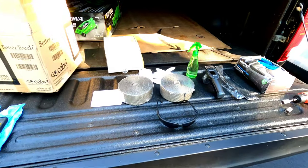Is wrapping going to make your pipes brittle or rot them? The answer is no. Most headers now are pretty awesome stainless steel pipe, so you shouldn't have an issue. The only way you'd make your pipes brittle is if you use the wrong overlap. Many companies have tested this, and the sweet spot is a quarter-inch overlap when wrapping your headers. Anything more than that, you run the risk of making your pipes brittle.